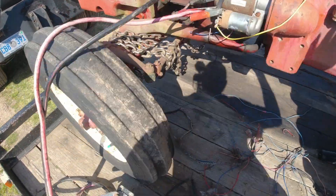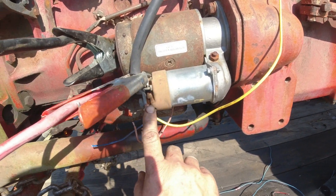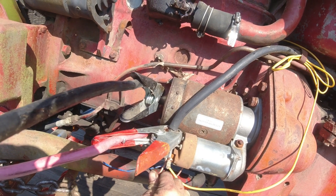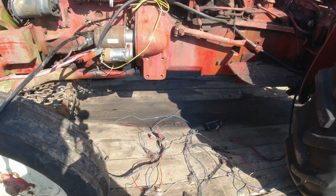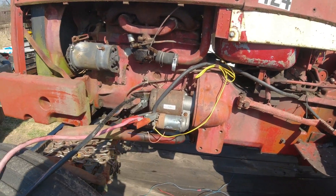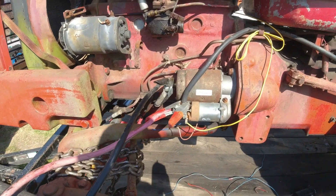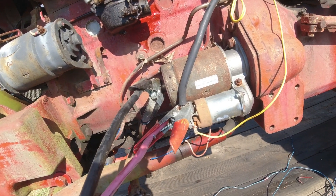Like I said it's a disaster, and the solenoid broke, so hopefully it'll hang on. I got the coil hooked up right here. It don't sound very good. Let me take this off where I can throw some ether in there and see if it's even hitting. The plug wires and everything are on the other side so I can't be on both sides at once. We're back — went to take that off and it fell off, didn't even need the screwdrivers. Give her a little shot — that'll at least let me know if it's firing or not.